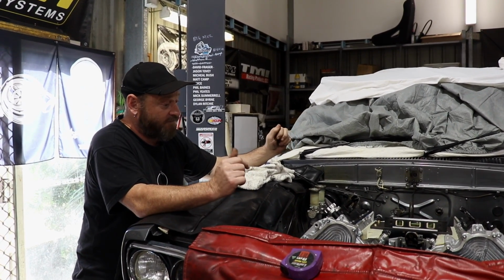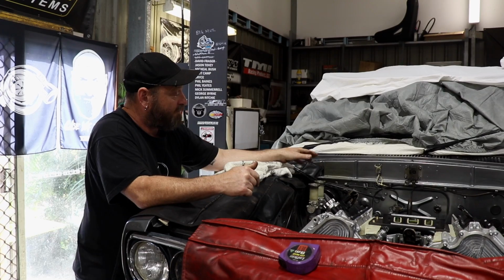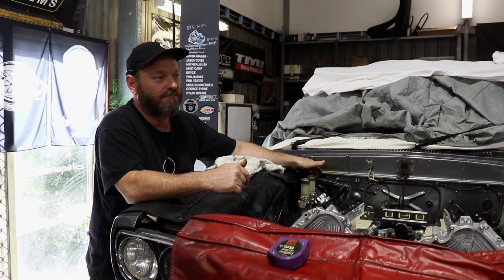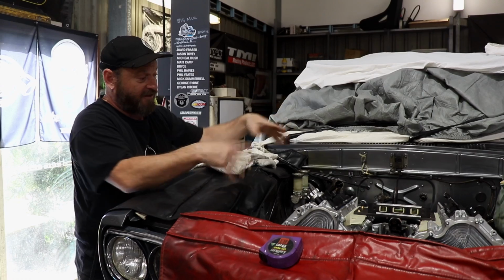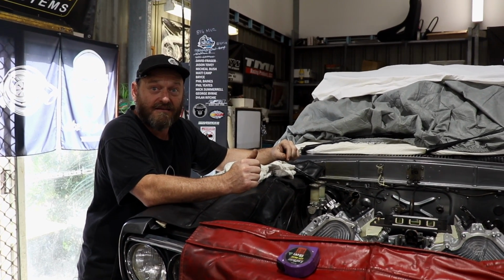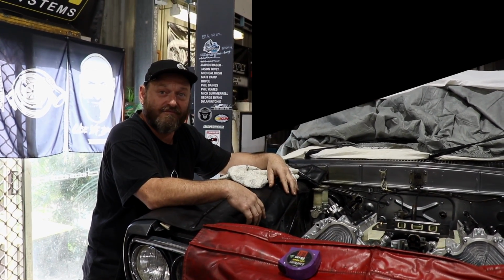So it'll come out again. We'll remove the steering box and linkage and all that stuff. Probably get rid of this because that's going anyway. It's not going to have a brake booster because, for one, it doesn't work, and for secondly, there's no vacuum from this engine. Clean up a bunch of other stuff and go and pick up some KE70 parts and see what we can meld together. I'll get back to you, Barry.